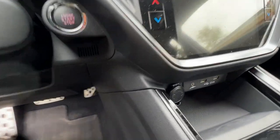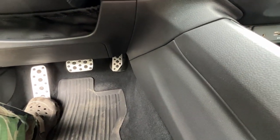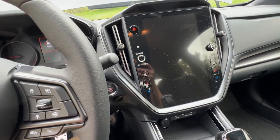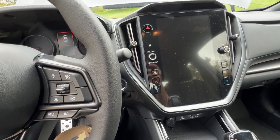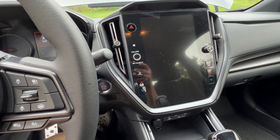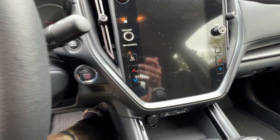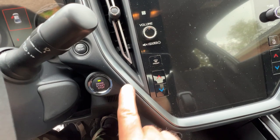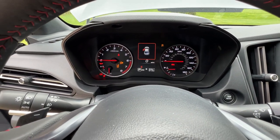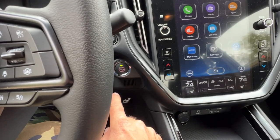One trick if you haven't heard: press the gas pedal all the way down to the floor as far as it'll go, then try to start it. It'll cycle through about 10 seconds and won't actually start — that'll pump the oil through the engine and get it back up into the filter and everything. Then hit the start button again to get it started. You can see it's not starting — okay, now it's done. Let off the gas, no more foot on the pedal.